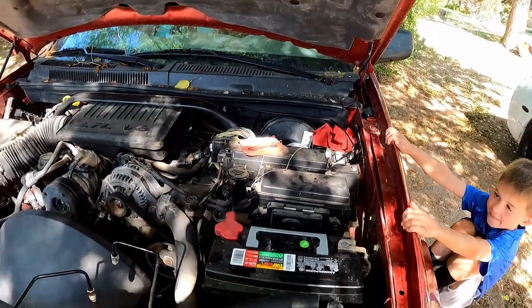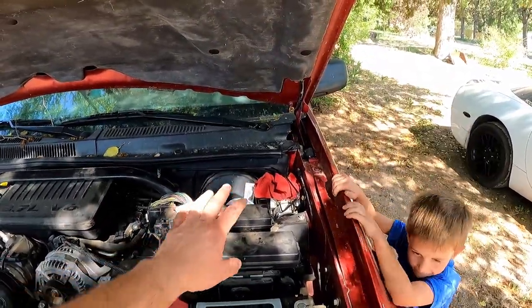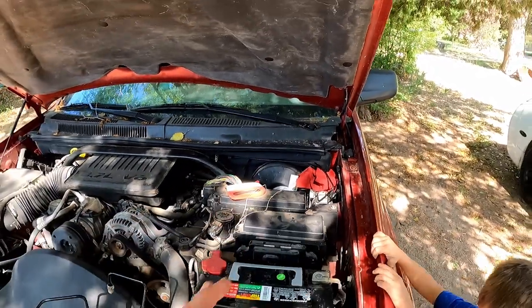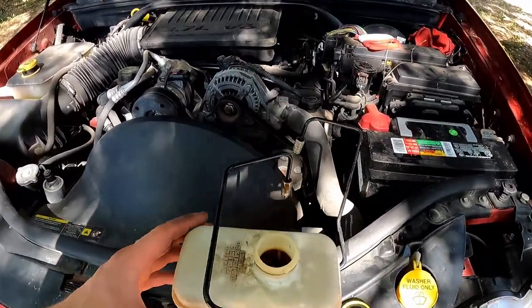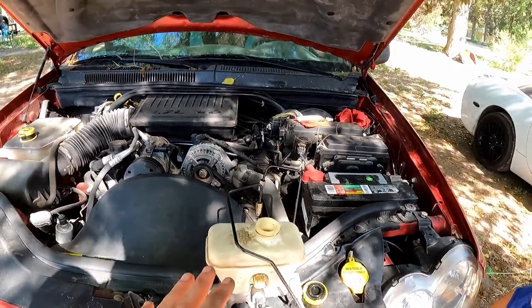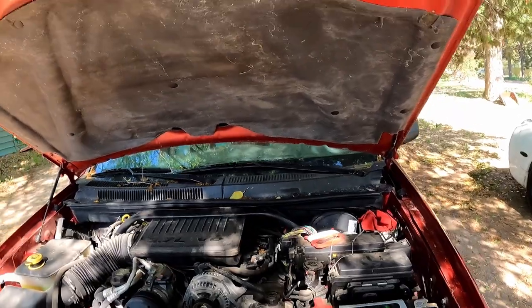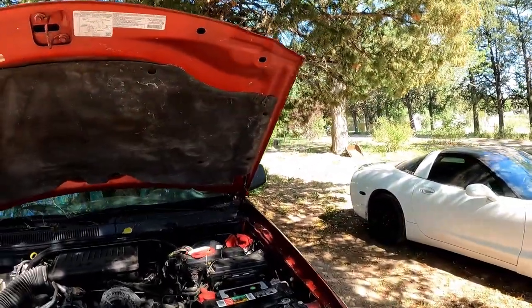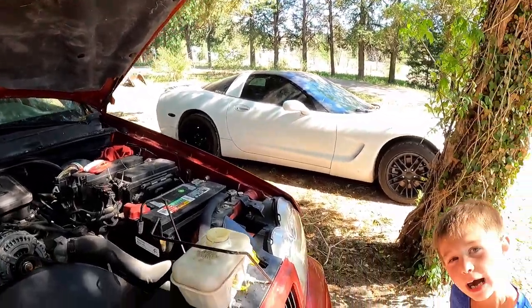Hopefully this helped you guys determine whether you need to replace your master cylinder and/or your brake booster. If your string or zip tie — whatever you stick down in there — is wet, the brake booster needs to be replaced as well. Since this one has a lot of contaminants and we can see that in the fluid, we're going to go ahead and buy a new master cylinder. If this video helped you out, smash that thumbs up, don't forget to click the red subscribe button, and Cohen says to ring that bell. Have a blessed day and we'll see you next time. God bless.